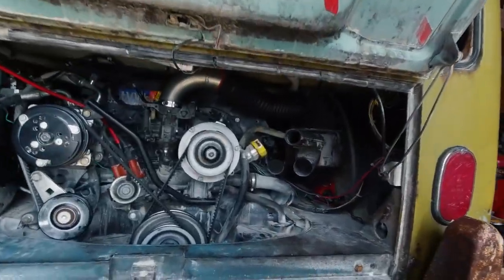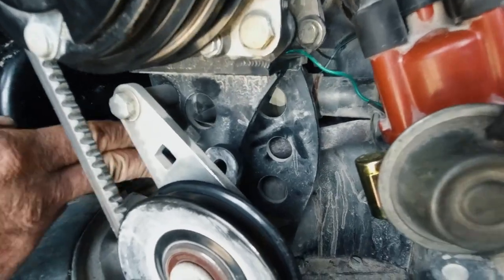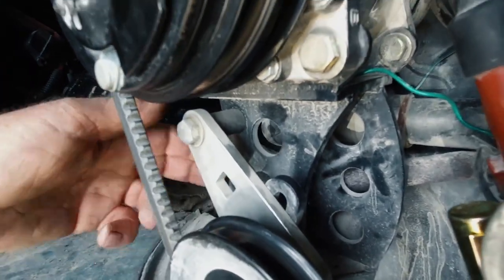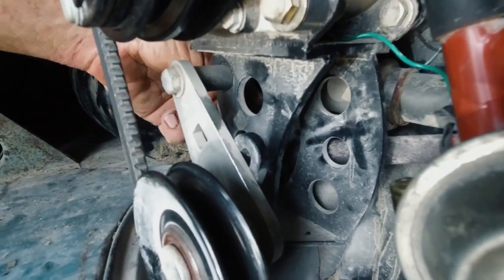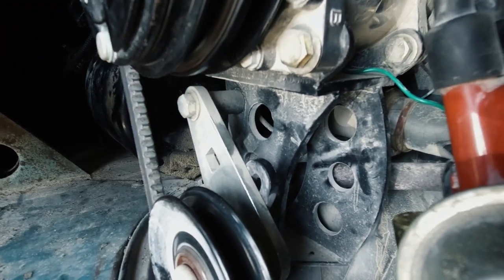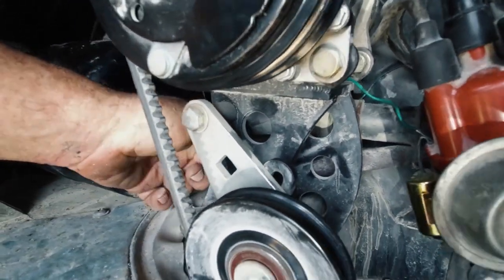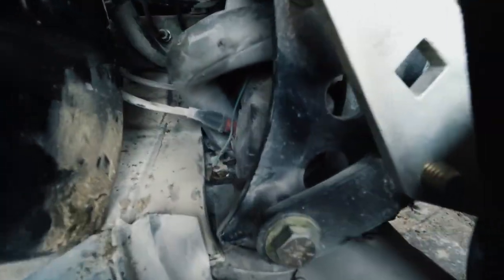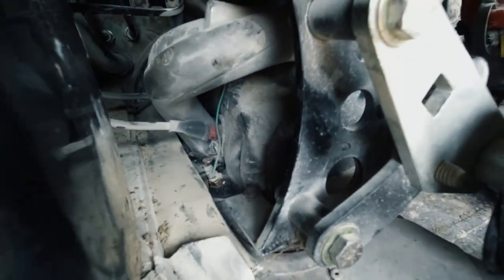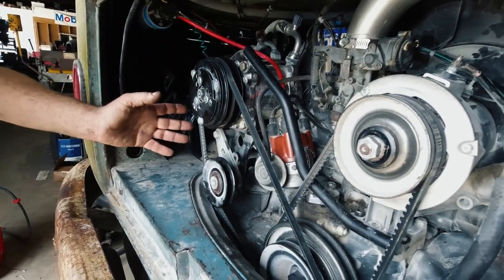What we did first was make an AC bracket, and I started this with it in the car. I started making the brackets and you can see there's really no place to attach anything to on a Volkswagen engine. So you have to go off the header bolts — the bolts that go to the head. I also made the top of that bracket bolt on top of the heat riser tube, so it actually has extra support there. Then after I got all that set, I knew the compressor was going to fit in the engine compartment.